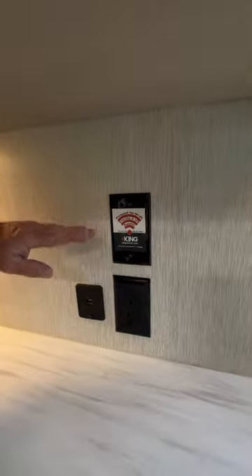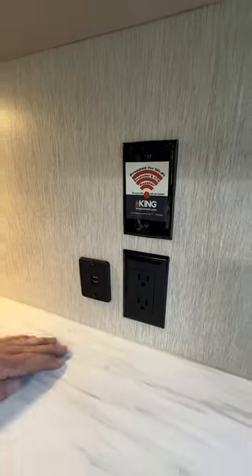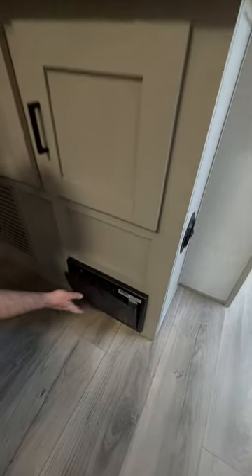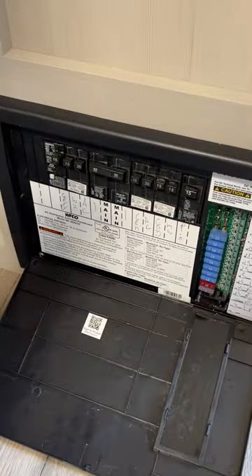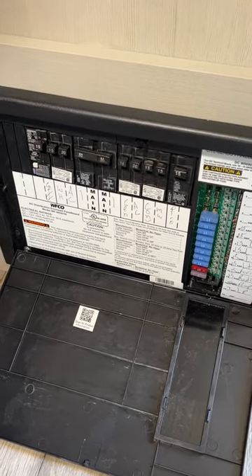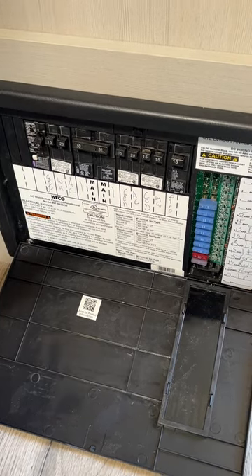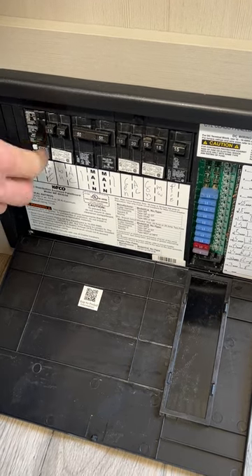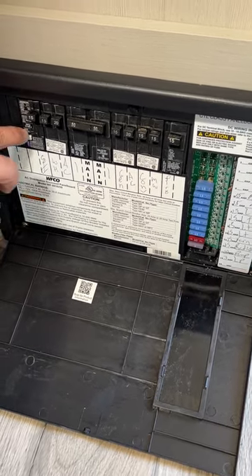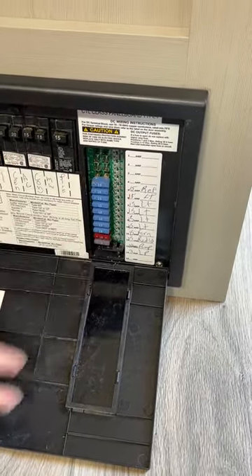This unit is pre-wired for a Wi-Fi extender or booster. You've got USB hookups for charging, and storage down below and up above. Down here is going to be our fuse control panel box. Everything that runs off shore power is going to be on your breakers. This is also where your GFCI is located. If I push this test button, I've tripped the GFCI — turn it off and flip it back on to reset. If you come in and see outlets aren't working, look for a light on this breaker. Anything that runs off the battery is going to be on the fuses, and everything is labeled right there for you.